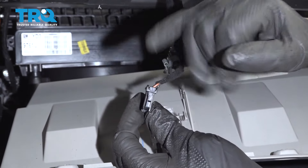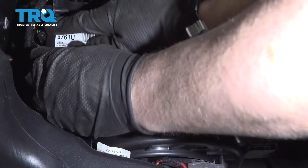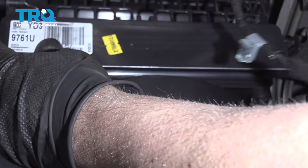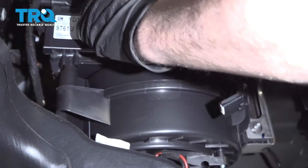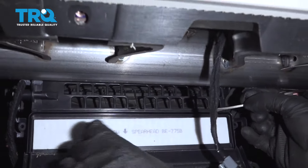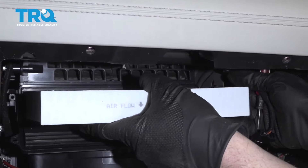There's a little lock tab — same. Now the door is right here. There's a little clip. There should be a clip on the side on this vehicle that's broken, and a clip on this side — that one's broken too. And then there's a clip on the top. Take a pocket screwdriver, just get underneath it and slide this down. Then you can grab the cabin filter and carefully slide it out.